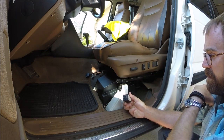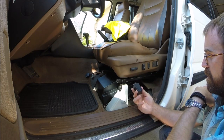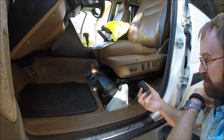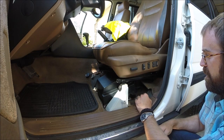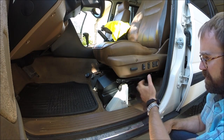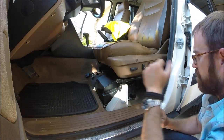This is the EAS delay relay — it's a specialty relay and we need to test it. First, inspect it visually and smell it for anything burned out. Inspect the receptacle, clean it out, and inspect the wiring — make sure nothing is pinched, torn, corroded, or damaged.